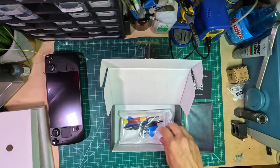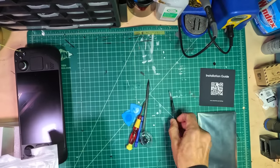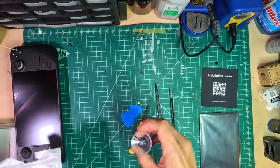As for the process of installing it, this is not a project for the faint of heart. If you've never tinkered with PC or console repair, this might be a little too intimidating. However, there's no soldering involved and almost everything you need to disassemble and reassemble your Steam Deck is included with the Deck HD kit — a screwdriver, sharp nose tweezers, a plastic spudger, another plastic pry tool, guitar pick prying tools, adhesive strips, and of course the screen itself. What it doesn't include is thermal paste, so get yourself some now before you start.